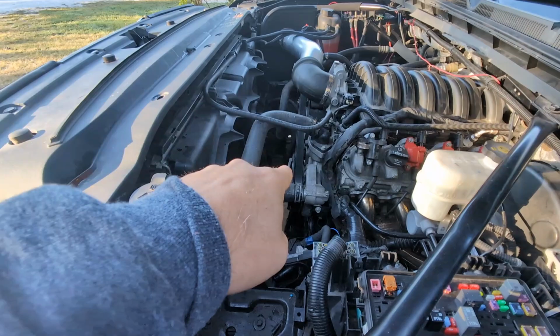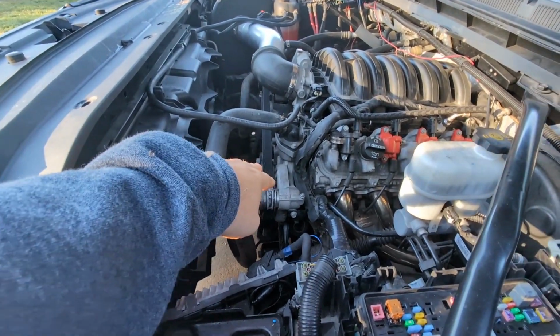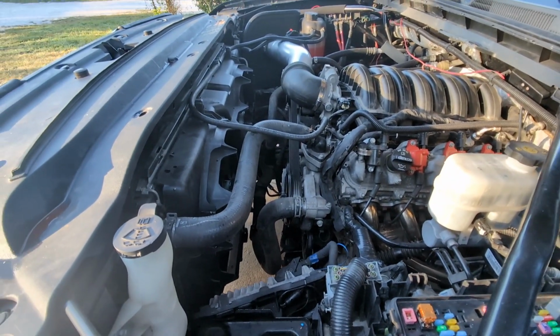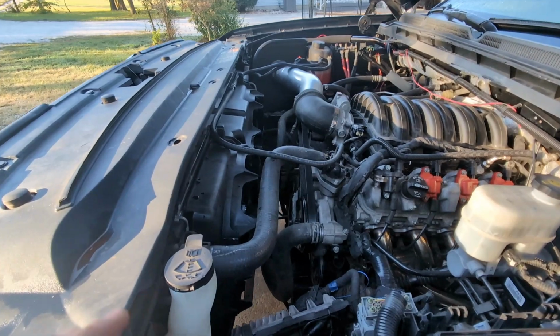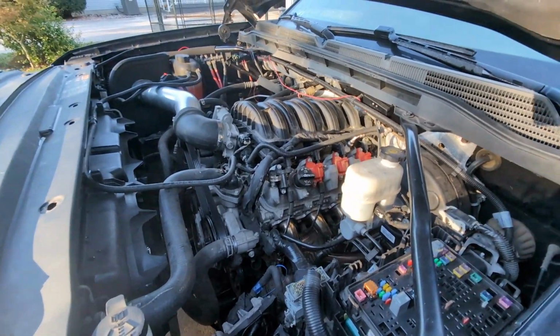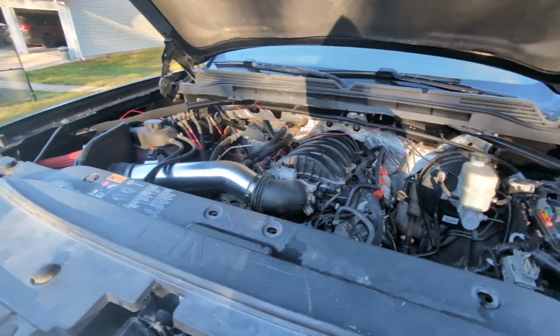Replace the water pump pulley. This whole part, actually just some bolts. The other one was bent. Replace that. That's good to go. Repair the AC pressure sensor connector so the fans don't run all the time. Rewired a few things. So good to go.